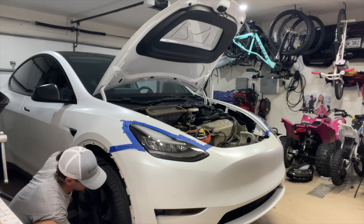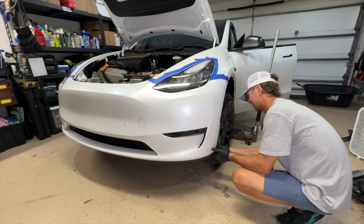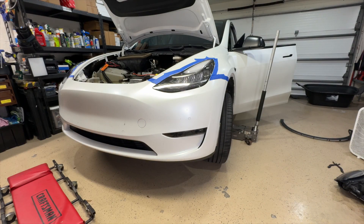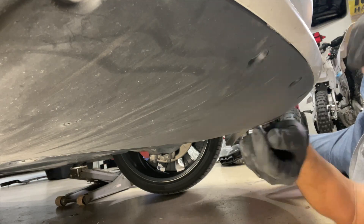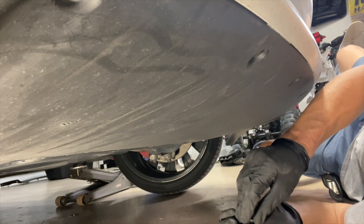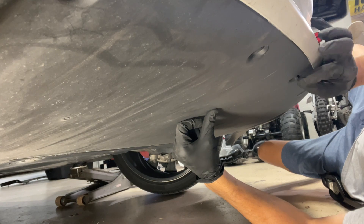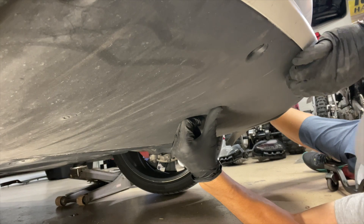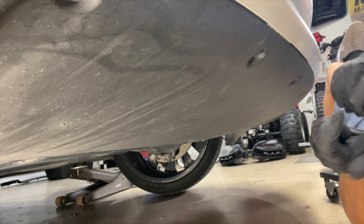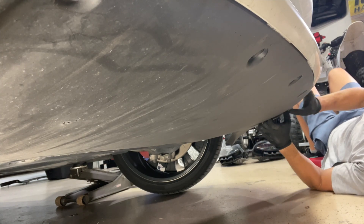Making sure everything got cinched up. Now the next thing I'm going to do is put the three pushpins that hold the fender well liner to that lower plastic valance — get the passenger side on there and then go and do the driver's side. I wanted to get the camera set up underneath so I could show you a little trick: I couldn't get that pin in place until I pushed on that lower part of that plastic valance. This is the front of the bumper looking forward — you just push up on that other piece and then it clips right in place. That just brings the lower valance closer to the bumper, making it much easier to get the pin to catch both the lower valance and the bumper itself.